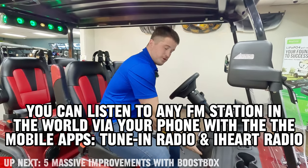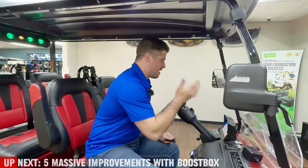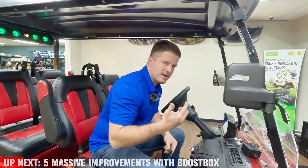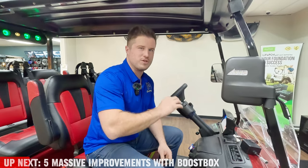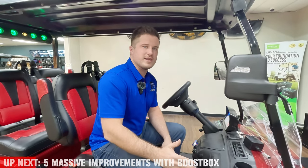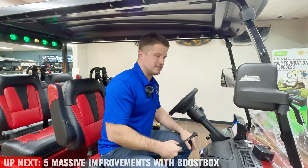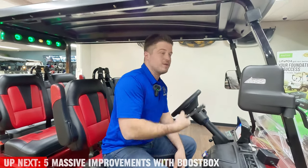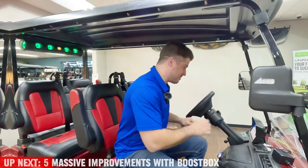Quick disclaimer: we do bypass the touchscreen. So if you love your FM radio, AM radio, or you use your USB audio and have music on a USB stick, you're going to lose those functions. The touchscreen just doesn't produce quality audio. Some people think if you add better speakers and a better amp it makes your audio better - that's true if your head unit already produces really good audio signal. But if your head unit doesn't produce good audio signal, you can put the best amplifier and speakers in the world on it and it's still going to sound like crap.